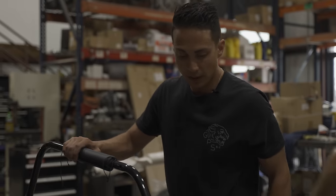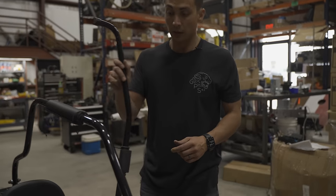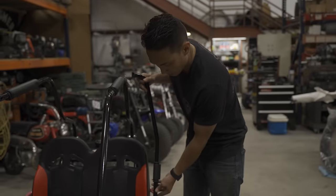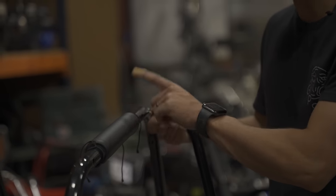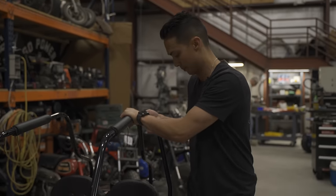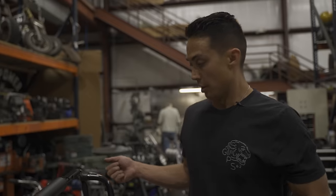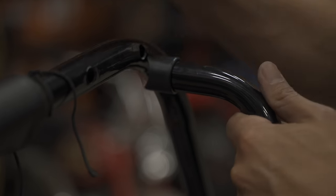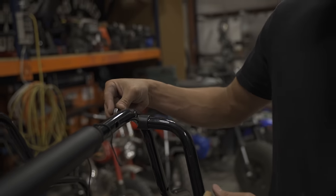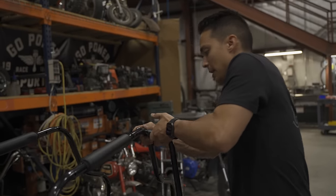We have the top roll cage loosely put on. Next, importantly, is to put on the side rails — left or right, it doesn't matter. Start by the bottom frame and run a bolt through here, because you're most likely going to have to pull on this roll cage just to make it all connect. Everything's pretty close, but as you can tell it doesn't easily just line up. I had to put this 10mm bolt and R washer through the top cage and bend it a little with my hands just to get it in.